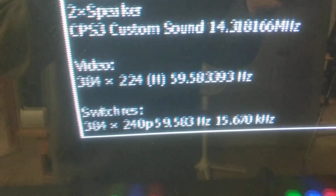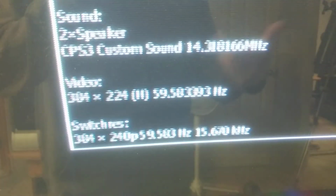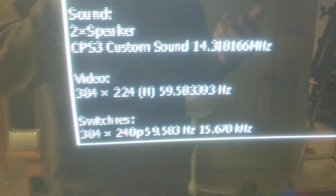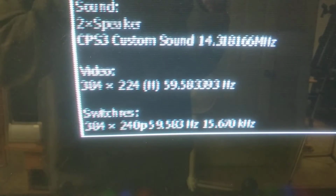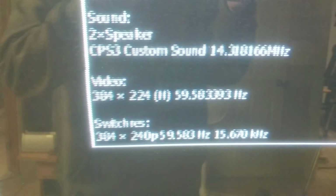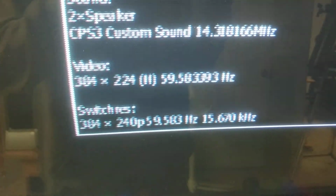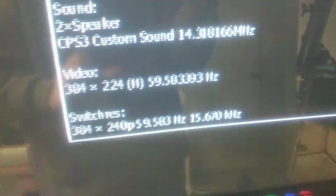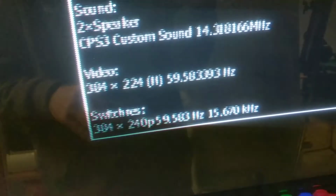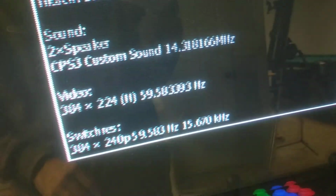What it does is that, given that you're using the CRT Emudriver, which enables multiple non-standard resolutions in Windows and makes them available, GroovyMAME can then leverage those resolutions for your consumer TV, arcade monitor or PVM, whatever you're using, any CRT tech that can display those lower resolutions. CRT Emudriver is going to unlock those resolutions. There might be a few tweaks you have to do, but that's not what I'm trying to cover here. I'm trying to cover the RetroTek.